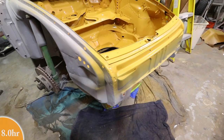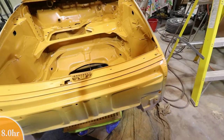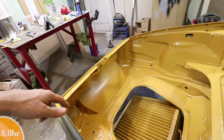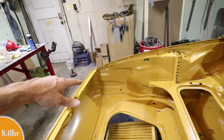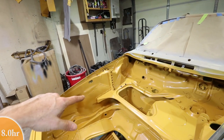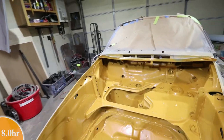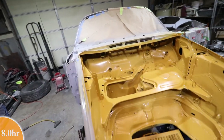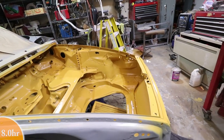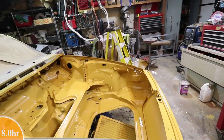So if you remember, this was several weeks worth of work. I mean, there is the oil cooler duct, there's the new suspension pan, the gas tank cover was repaired in this corner area over here. The impact bumpers are removed, the seams are welded, the brackets are added for the strut brace, and everything's been cleaned up, undercoating removed. Also, I can have kind of a clean, smooth look here on the trunk area. I want to customize the gas tank in this to use an internal fuel pump, so that's coming.